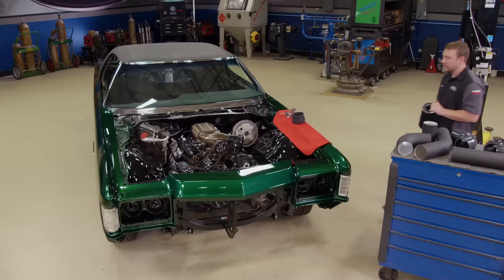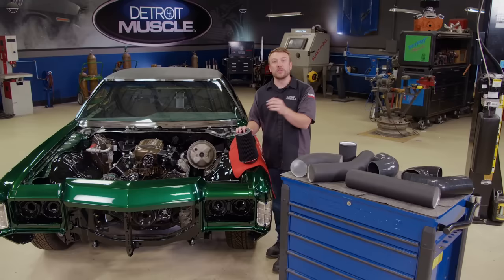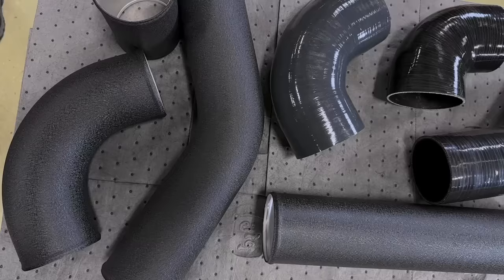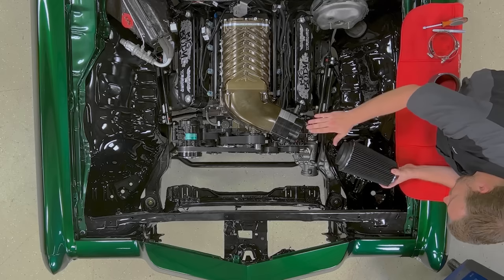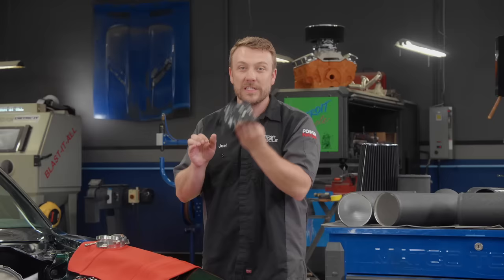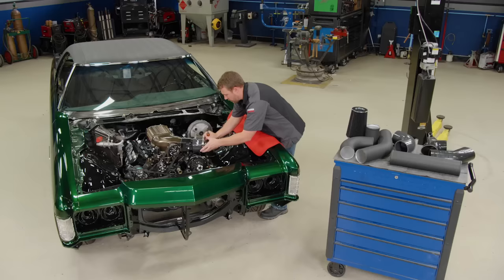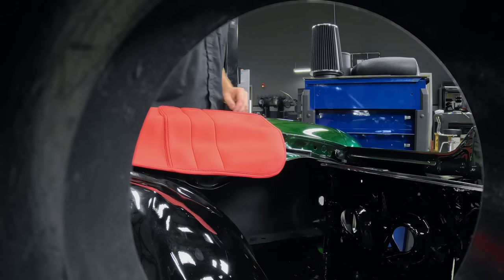The air filter is only one piece of your air intake system's puzzle, and a lot of times when you're doing an LS conversion, you're literally going to have to start from scratch and build your own setup. There are plenty of companies out there like Summit Racing that offer kits to accommodate any size, style, or material you're going for. Also consider hood clearance — these things are pretty bulky. The OD on our throttle body is slightly larger than the tubing we're using, so the first thing we need to install is a reducer made from a flexible material, which is important because you want something with some give to absorb normal engine vibration.